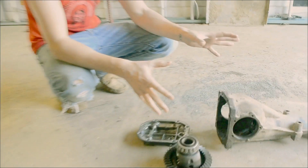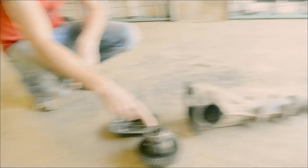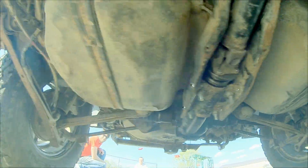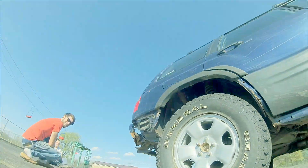This is the remains of the rear diff out of this car, the second one. This is a viscous limited slip differential, an R160. Essentially what you need to do is disconnect the differential altogether, which if you're swapping it you're going to need to do anyway. Then let it drop down really low, and that gives you just enough space in the CVs to get the CVs disconnected out of the differential.